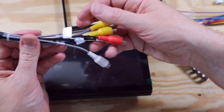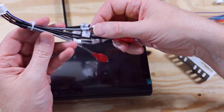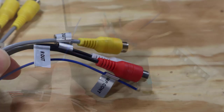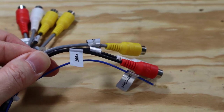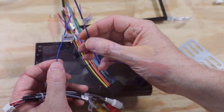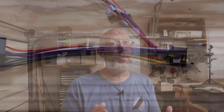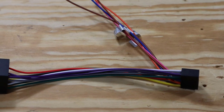Next, there's the wire for the various AV inputs and output. It has an amp connect — so this is your amp turn-on lead. The other harness also has an amp turn-on lead, so this has two of them: one labeled antenna, one labeled amp. This is strange. The industry standard is a single blue wire that can turn on the amplifier or the power antenna. I'm not really sure why they felt the need to include two turn-on leads.